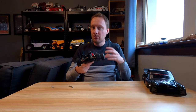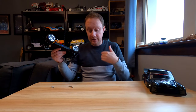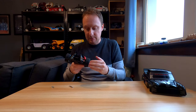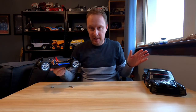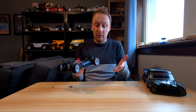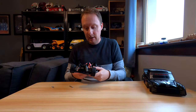As for being on throttle, I don't think I was on throttle when that happened, but I'm not entirely sure. I can't say for certain it wasn't my fault. However, as you saw with Matthew, there is a delay when it comes to this radio system. This is me hitting the throttle now. I've used a few RCs with 2-in-1 ESC and receiver systems, and every single one has been junk, without exception. There's almost always a delay, a horrible lag in the response. And it could have been that I was on throttle half a second before when it leapt up in the air. I was off throttle, but that input lag meant this was still on throttle, if that makes sense. It could be that, or it could be my mistake.